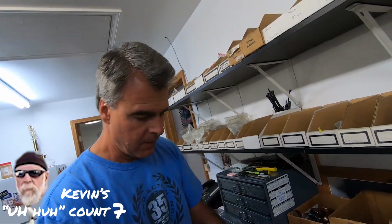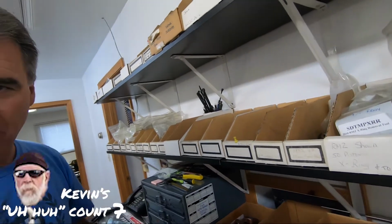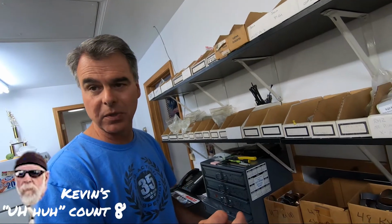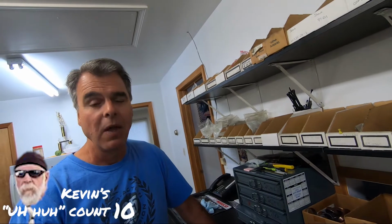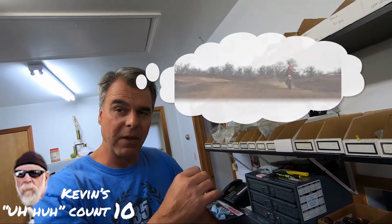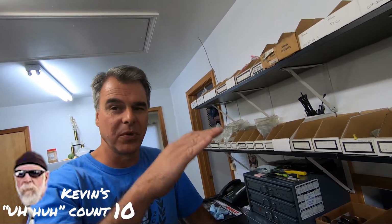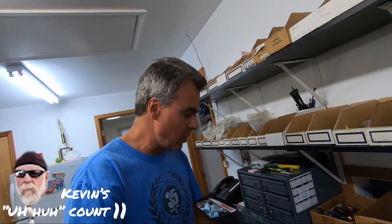So it's just one stage normally. Yes, normally it's just a single stage. Sometimes I'll put one little shim between the two as a pivot and do a 2-stage. The problem with the 2-stage with the pivot that they use, a lot of times if you're coming through a whoop section in motocross, a big braking bump section, there's enough pressure to open that first stage, not quite enough to open that second stage, and it pushes the shim into the second stage, and it'll stop for a split second and build pressure till it opens that second stage. That split second is what throws you off balance.